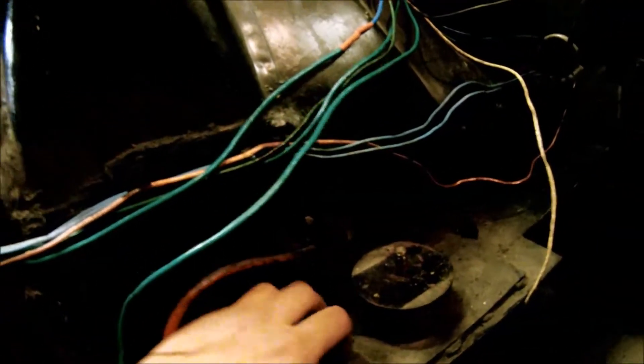So I'm back inside the engine bay and I thought I'd give you guys a little bit more information about my original motor mount setup. I made it years ago — it's probably not the best design, but it has worked to hold up an engine of similar weight. So what we have is Jaguar motor mounts — no idea what model they came off, just jump on parts doors until you find ones. On top of the Z's frame rails here, I had probably 3/16ths plate welded on top, and then I also braced it with some angle iron below, drilled some holes, and plug welded it to the frame as well.